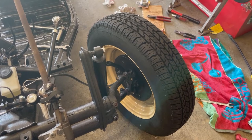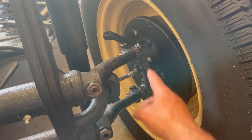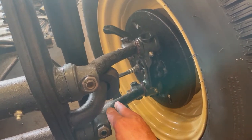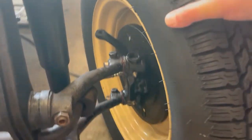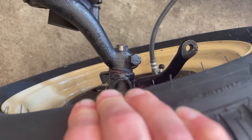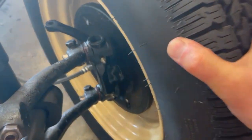Here is the source of that clunk - it is the link pin that runs the length here, that attaches the lower torsion arm to the upper torsion arm. There's way too much play in this, and I could see the actual play just by wiggling the tire here. It might be difficult to see on camera, but I can certainly feel it when I tug on that tire.